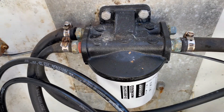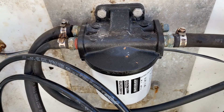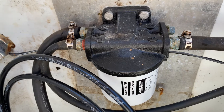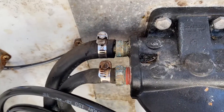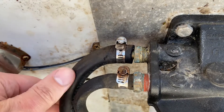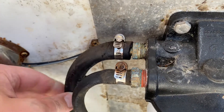Hey Bruce, here's the fuel filter you guys installed. Remember you noted in the notes that you had hooked it up to a test tank or a shop tank to run the motor. The only thing I noticed here is this clamp is not fully tightened. This is the line that comes from the fuel tank and this is actually wiggling loose right here.